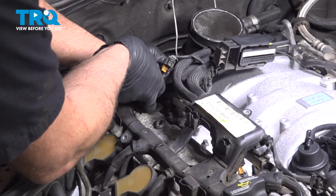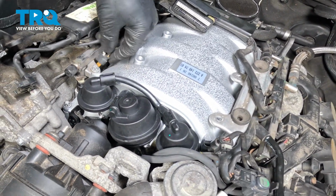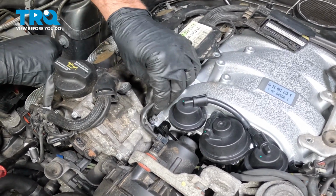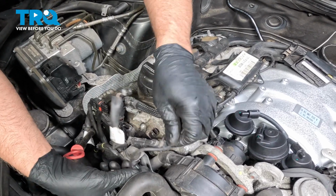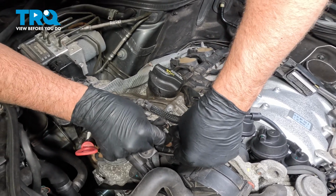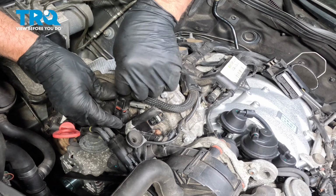This connector here in the back, we're gonna slide that in place. That's gonna go into the manifold, intake manifold. Then all these other injector connectors, we wanna plug those in. Lock the injectors down. Just like that. Take this plug, line that up, lock that down. All the other plugs over here. This one's gonna go down below. This one's gonna go right here. Push it down. That bracket on there. And connect all the connectors.